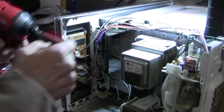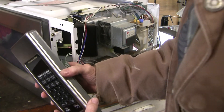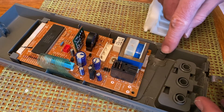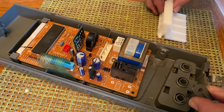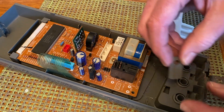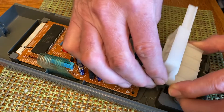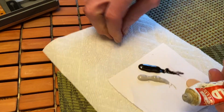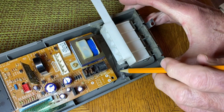I don't remember exactly how this came out, but that screw there obviously needs to come out first. For reference, there's one screw up top and a second screw at the bottom. Some years ago, I glued this end because it had broken out on this side, and I was able to pry the plastic piece in after gluing because the other end was flexible enough to permit it. But once I glue it on both sides, I don't think it'll have the flexibility. So I'm going to glue this with crazy glue first and then JB Weld, with the plastic device in place while I do that glue joint. I don't usually use two types of glue, but in this case the bracket wasn't easily braced, so I froze it into place with crazy glue and backed that up with JB Weld to give the joint more substance. Plastic doesn't always play nice with glues, but that strategy worked perfectly on a past repair of this oven.